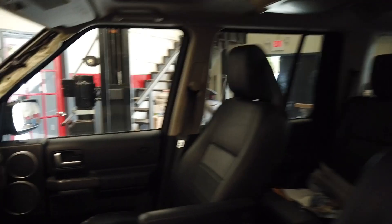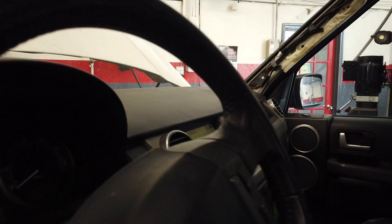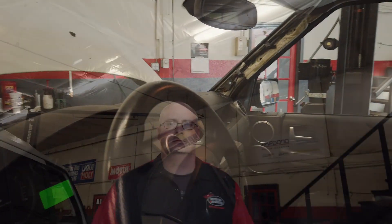So just a faulty compressor and we got her fixed. We got the air suspension fixed — no fault codes in the air suspension, everything works great. I did put a used old-style compressor on it, not a new AMK. Didn't have to program anything. I did leak test it and everything turned out okay. Air suspension is fixed.